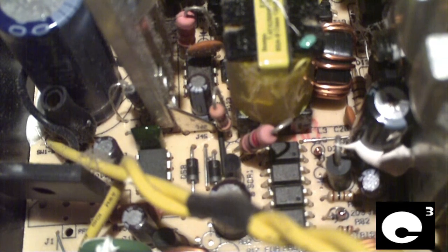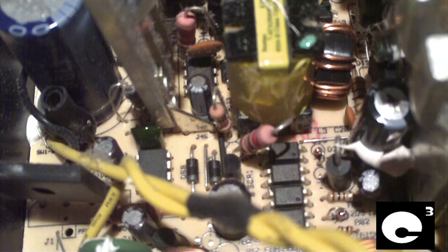These capacitors are located on the 5-volt standby rail. When they fail, they can cause some serious issues with the power supply, because the 5-volt standby rail controls the electronics that tell the power supply to come on and how to regulate. When these particular capacitors fail, they can cause serious issues, and usually what will happen is the power supply will stop working. That seems to be a very common reason why power supplies just quit working all of a sudden — their capacitors fail.